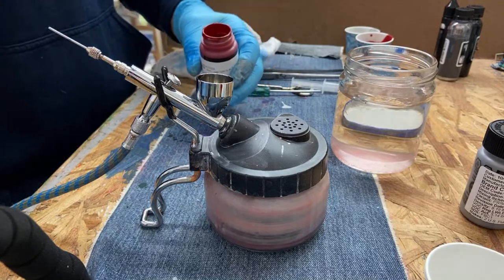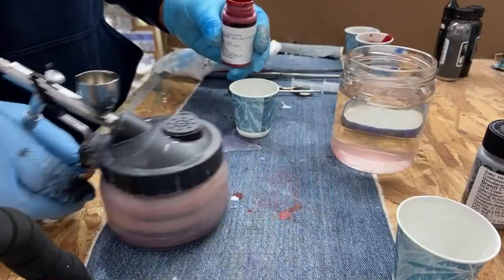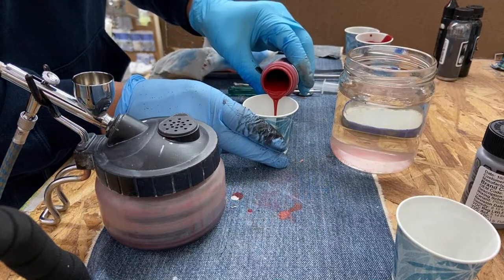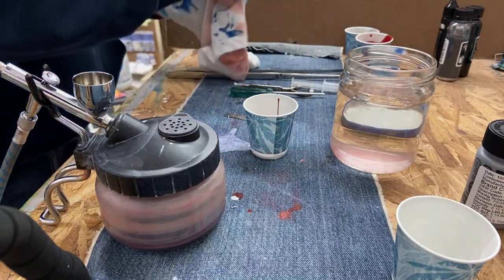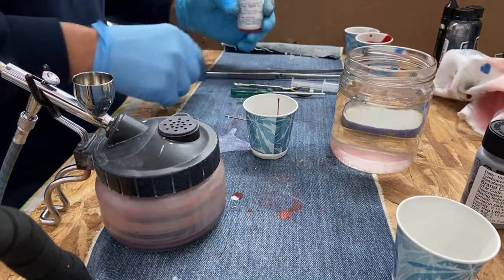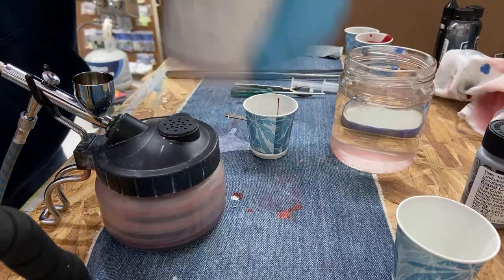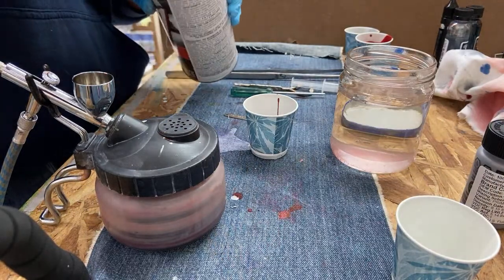It was dumb luck that I can use this shade of red on Shelby's and the other guy's truck, I forget his name, Jason, is it? I don't remember. Anyway, on his truck, I couldn't pull his particular paint code for some dumb reason. I got an International four-number VIN, and that's a disaster. I think it's a Sikkens color, and those are hard for me to match out here in the sticks. DuPont paint code's no big deal, but Sikkens, yep, that's a pain.